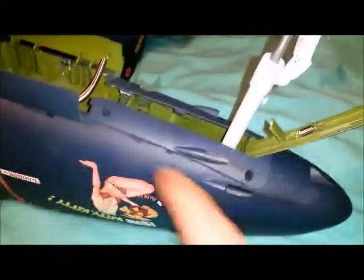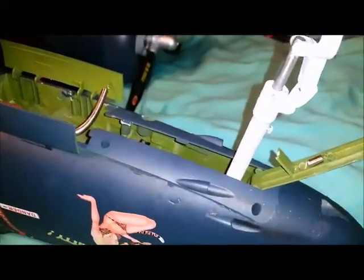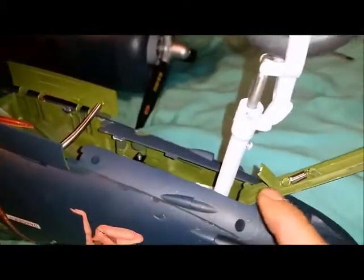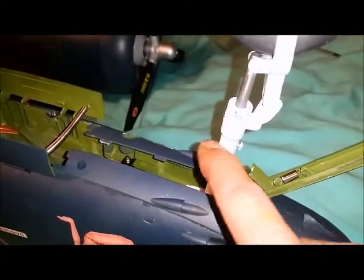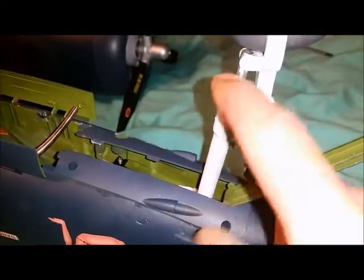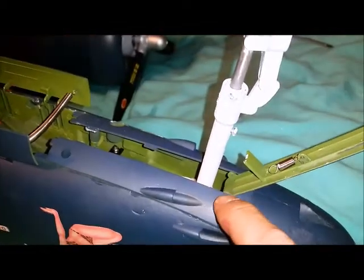So to recap here, I've stretched the spring a little bit. That's a trial and error you'll have to play around with. I actually had it overstretched the first time and had to replace it. I have already bought spare springs. I put the strut in, which is a drop-in. I shimmed a little piece of extra metal spacer there to limit that piston travel movement, and that's the biggest mod right there. And I've added some additional washers under the front here to help angle the strut back. I wanted to keep the forward rake of the strut. These are what I've used.